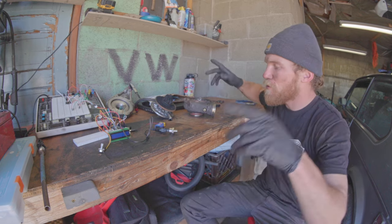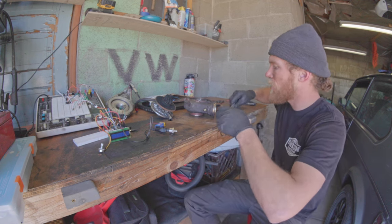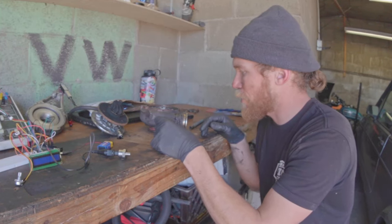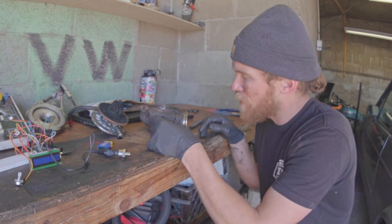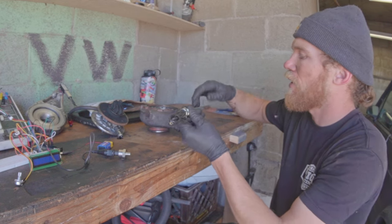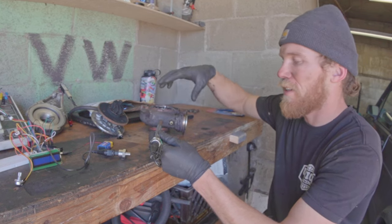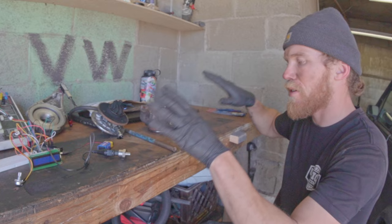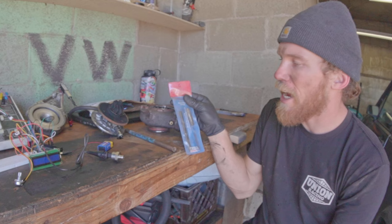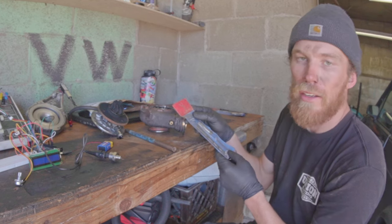A few more things I want to do today — I want to mount a pressure sensor to the turbo, but this sensor has a lot of plastic on it. If I put it right here and this turbo hits a couple hundred degrees — or thousands of degrees in places — the plastic will likely melt. My plan is to add a pressure tap to move the sensor away from the really hot area. The other sensor just goes into an intake tube, which is as simple as running a pipe thread tap through the tube, drilling a hole, and screwing it in.